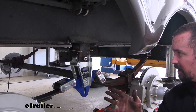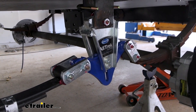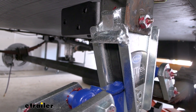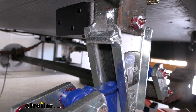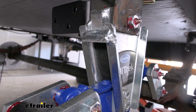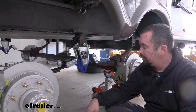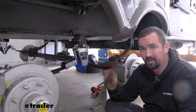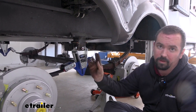It's not required to have a cross-member kit as well. We are going to be putting one on here, so yours may not look like this, but it is not required. Not only do you get more suspension travel allowing the suspension to work better, but you also have 40% more rubber absorbing those shocks. It's also progressive, so as it presses up it fights against that and really settles out the suspension. This comes as a quantity of two, setting up tandem axles with one kit. For a triple axle, pick up an additional kit.